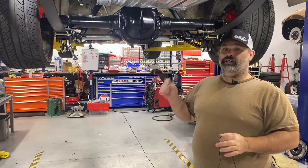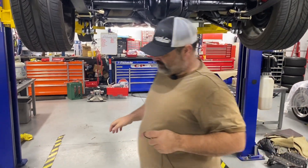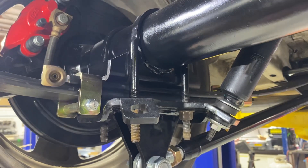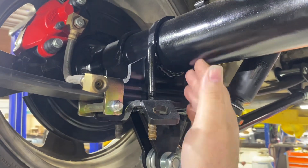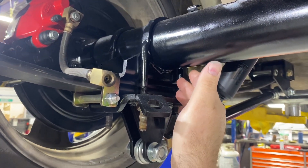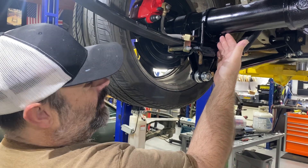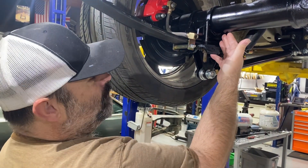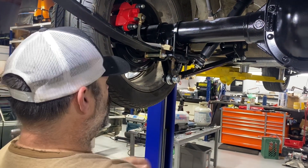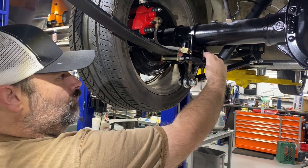Here's one thing that's going to be super important, so grab your pencil because I'm going to show you a part and a part number. With the Fairlanes, the wheel houses and the axle centerline were originally so far forward you couldn't run a tall sidewall tire. A lot of guys run 15-inch rims and once they get up to 26-inch or so tires they rub the front of the fender. The idea — and the Thunderbolt cars did the same thing — is they moved the centerline on the leaf spring and the axle one inch backwards to allow more clearance in the front of the wheelhouse to get the taller tire in.